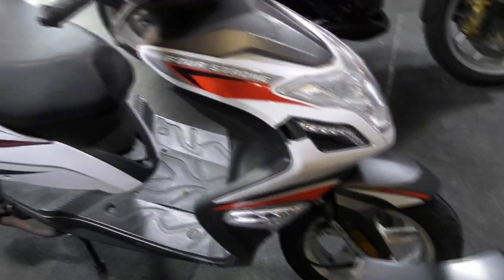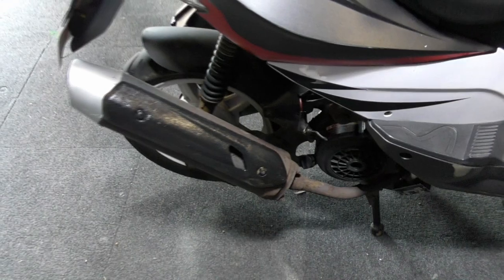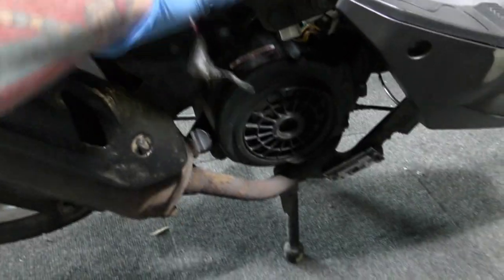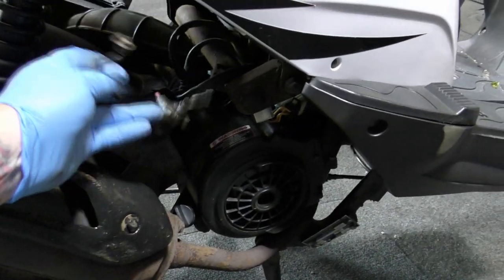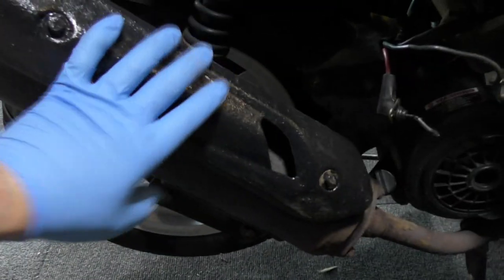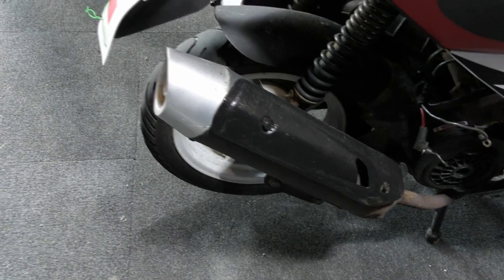On first look it's not too bad — a few little marks, a little crack here. It does look like it's been down the road, but probably a very small little spill. Hand-painted that — you should rub that down and get some heat-proof paint for the exhaust. Now, you might notice some wires here — he'd changed the starter motor but left the original wires. You've got to take them off if you're selling the bike. The rear suspension — well, I can tell you they're gone. They're too springy; the dampener's gone, so all you've got is spring.